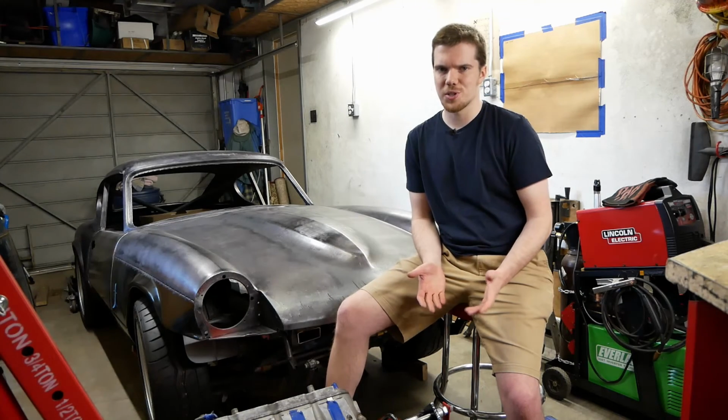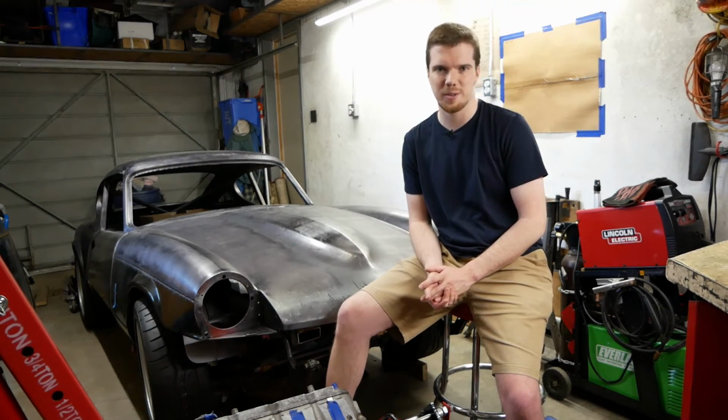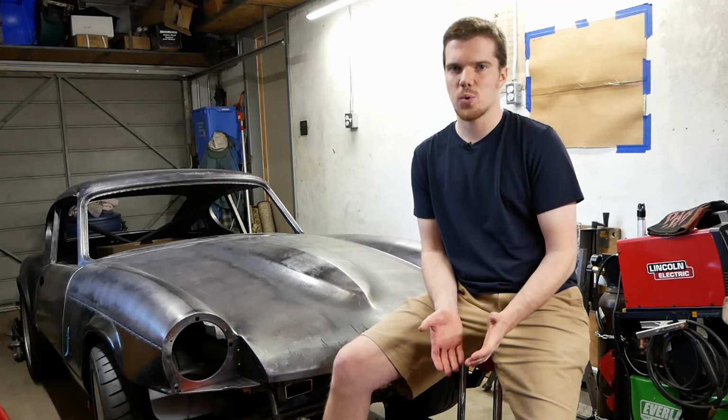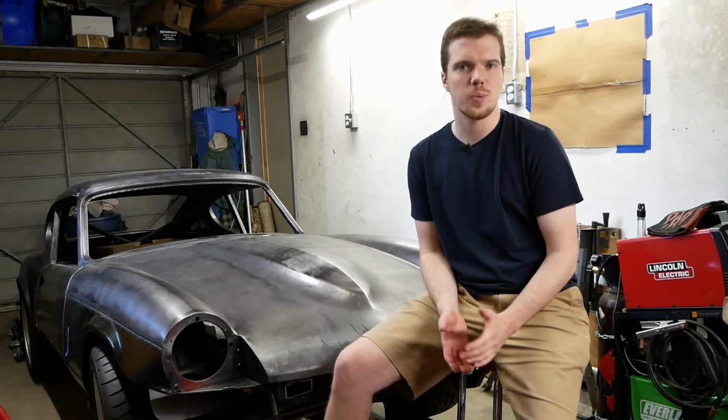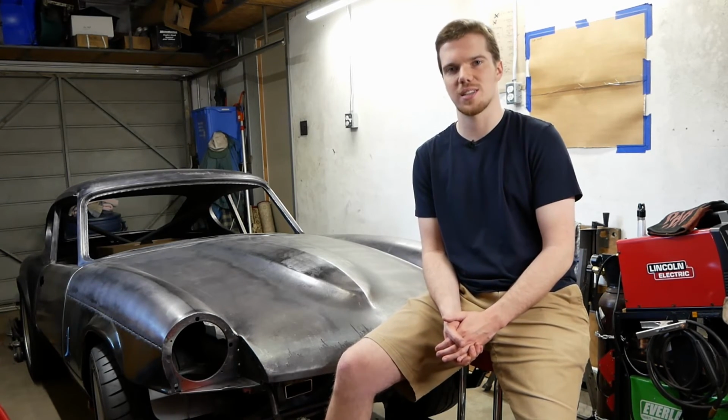You'll also be closer to, if not on, the suspension bump stops, which will make the ride more harsh and less predictable under acceleration. Anti-squat works by using the reactive torque from the wheels to act on the suspension and provide a jacking force to combat the car's weight transfer under acceleration.